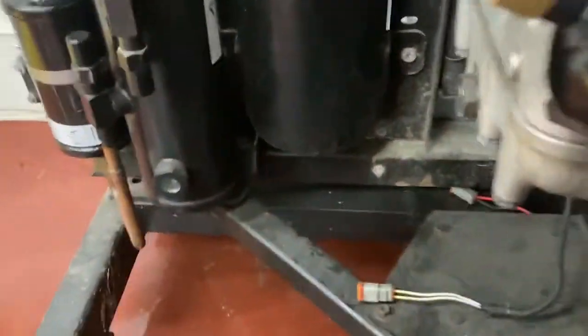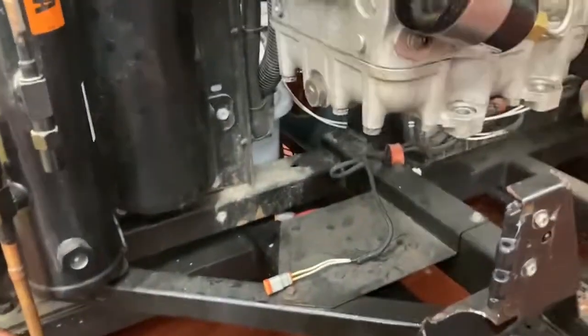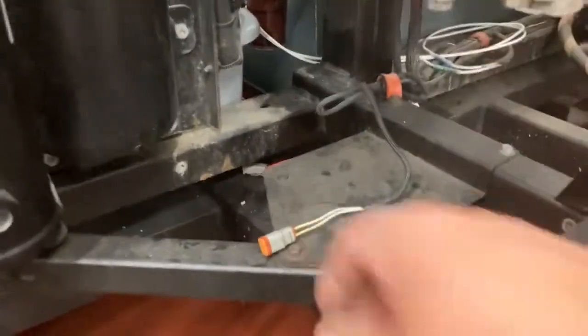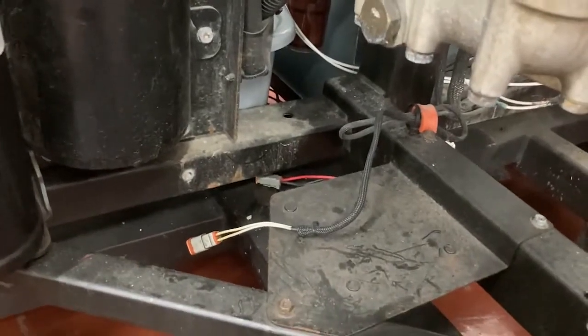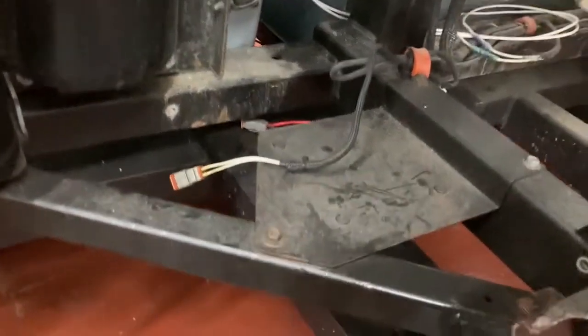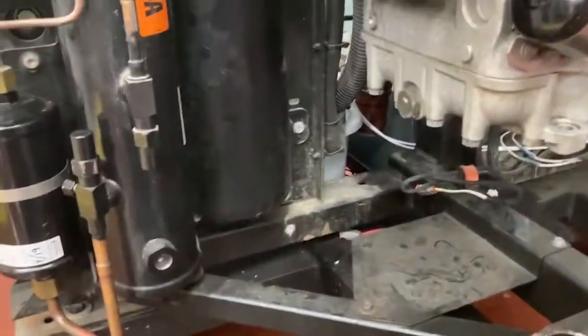This unit had some other optional connections to the wiring harness — they're just hanging here dangling. If it's a two-pin plug, one of them is power, so you want to bundle them up and zip tie them so that they don't wear through, short out, and cause a problem.